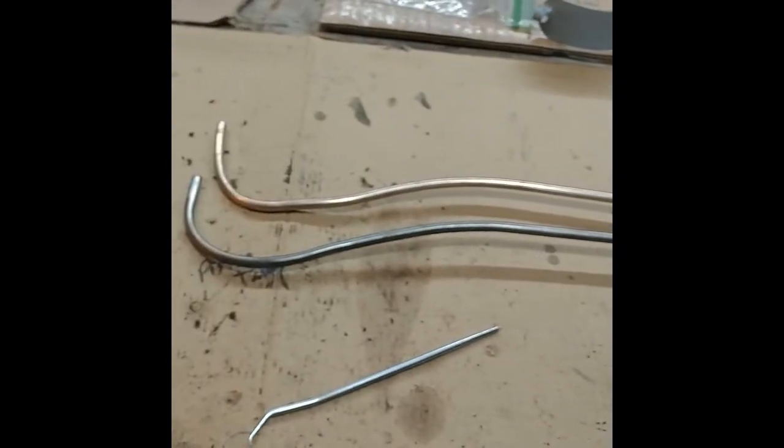Just cleaning up my fuel line, and I noticed it's got a cavity. There's a hole right in there. I don't know how it ran before. Never noticed that, but it looks like it must have been rubbing on something and wore all the way through. So I guess we'll be bending a new one since it's $30 to buy one from the parts store. Maybe that's a reasonable facsimile. Took me 5 minutes, saved me $30.